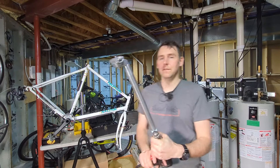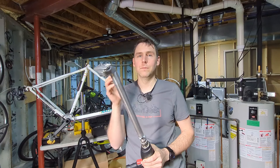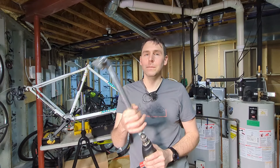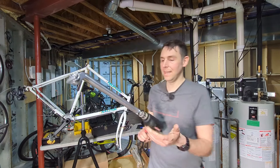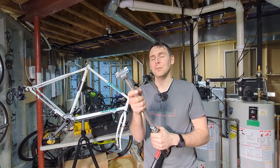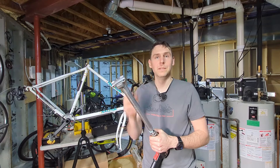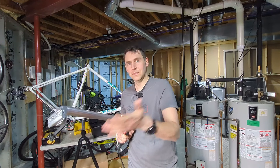It will slip if you put too much pressure, but now I basically have a little lathe. You can use various types of sandpaper to polish this. Right now it has a dull finish. When I started I used 220 grit, then went with 400. I read about polishing aluminum and apparently you can get a mirror polish at 1000 grit, so I went to the hardware store and they had 600 grit and 1500 grit. I'll try 600 then go to 1500 and hopefully that's enough — it's quite a big jump so we'll see.